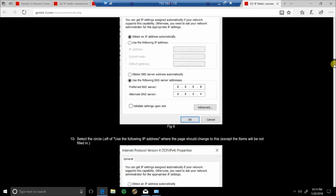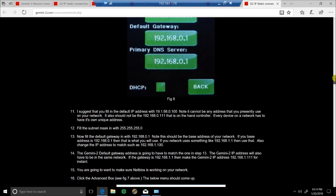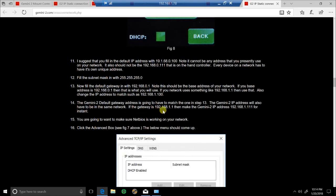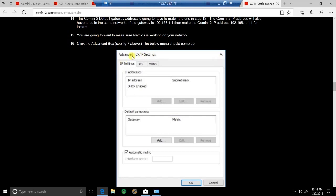Go with the settings you see in mine — those will work. Click 'Use the following IP address,' put in those numbers I gave you — 8.8.8.8 and 8.8.4.4 for the DNS. Don't worry about the default gateway — I've tried it with and without and it defaulted without it. This is where it gets a little confusing, but just go with what I put in there and you should be okay — it worked for Chris too. When you're done, go to Advanced.